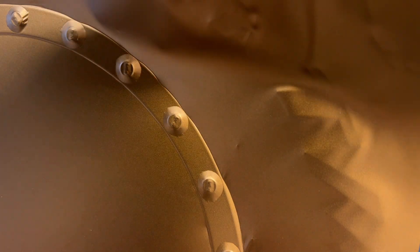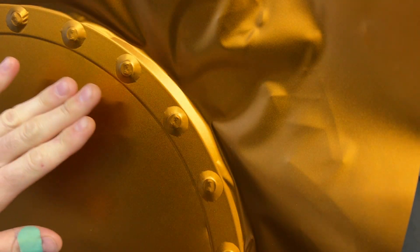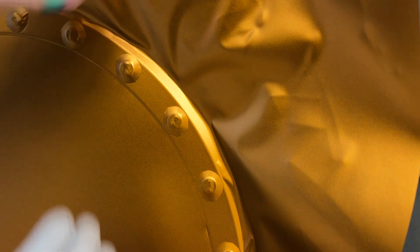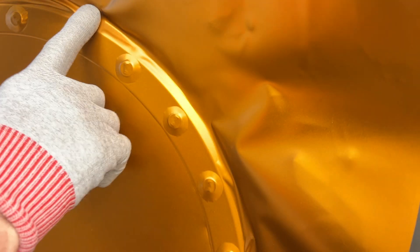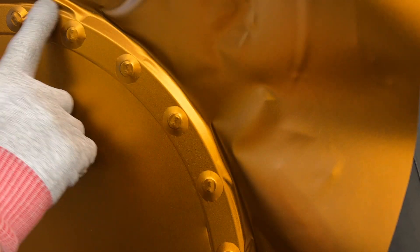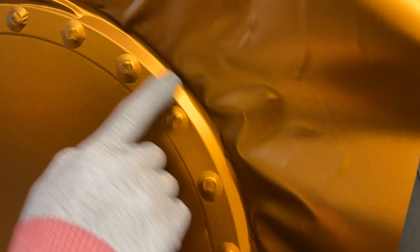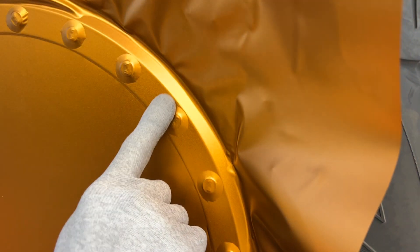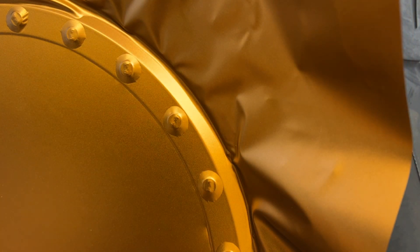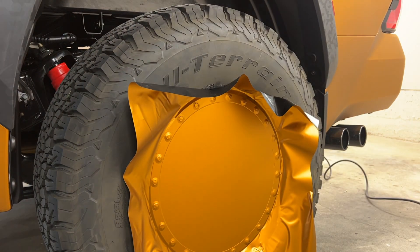Now I'm going to pull the wrap back a little bit so we can get a nice tuck there on the edge. This is why it's important to go little by little — if we pushed too much in one area we'd get a lot of wrinkling. So it's really important that we go evenly all the way around, and then we can just push it right up to the edge where the wheel meets the tire. Everything is nice and evenly pushed out with no wrinkles and no over-stretching. I'll grab a squeegee.